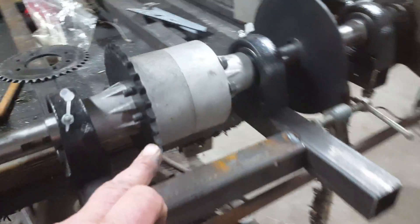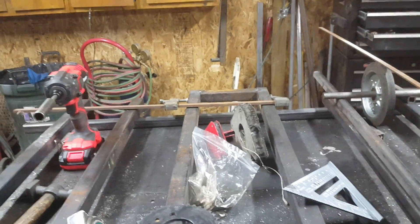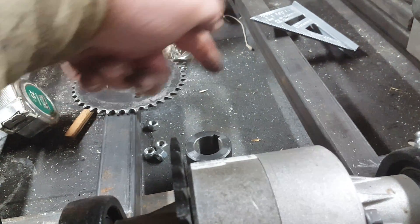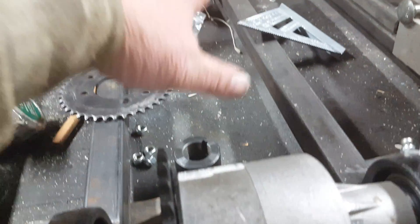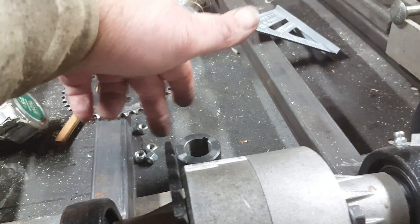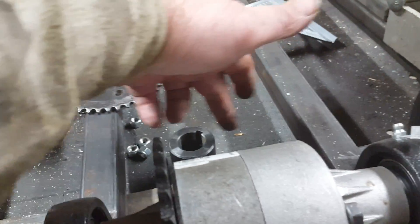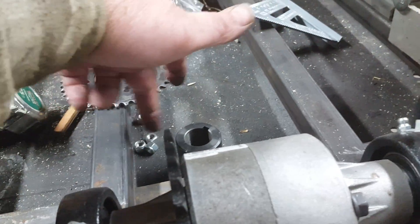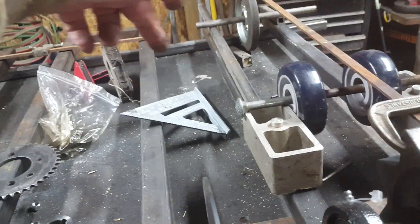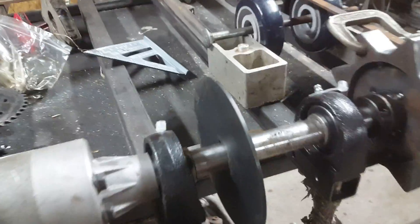Six and three-eighths here. Six and three-eighths in the back — and that's a good start. Not sure where the next one's going to go because there's a chain from your jackshaft and you've got to get that all mounted with your engine stand, and you've got to miss your chain. But as soon as I can, I'm going to put another brace in there and try to keep that thing from flexing at all.